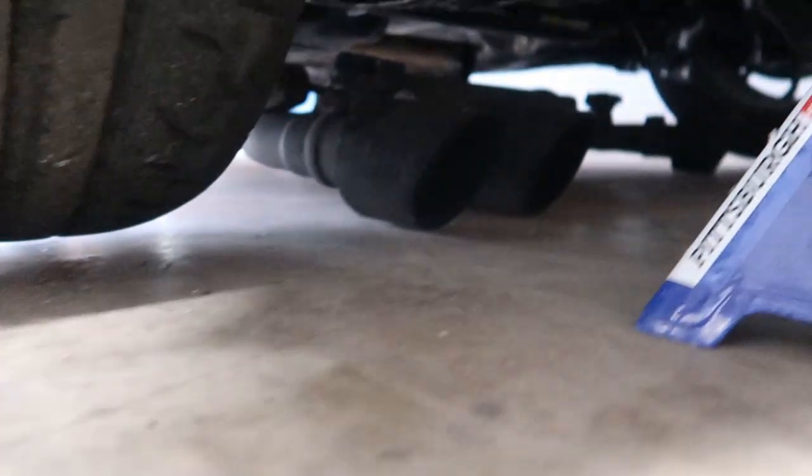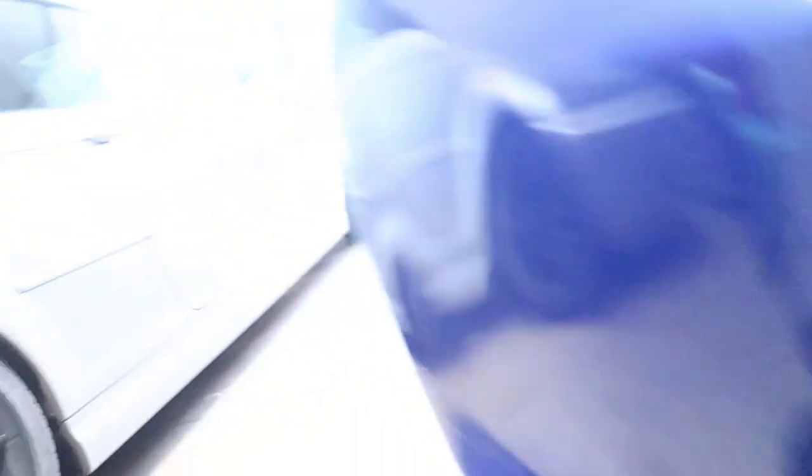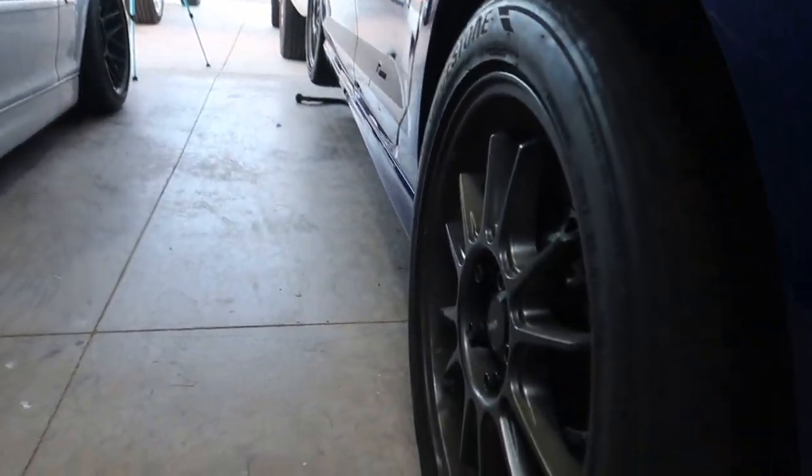Got the car up on jacks. I couldn't use that tool for the rears because the cables don't reach, but if it's plugged in inside I'd be able to reach each corner. I used to put the jacks on the back on the old subframe - there were flat spots on either side near where the control arms went - but I don't want to put jacks on this tubular frame, I'm scared I'll bend or break something. So the jacks are maxed out on the frame rail. I've got about half an inch on either tire to get them off. The toe is kind of off - I need to bring it in.